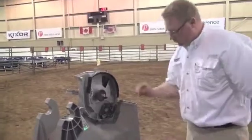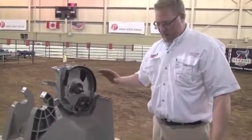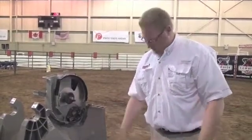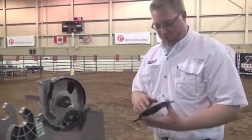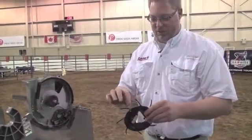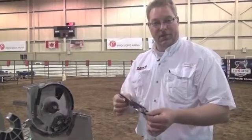Now that we've done that, we can start inspecting our items to make sure everything's still in good shape and clean as needed for winter storage. Starting with the agitator — the last piece we pulled off — we want to check it over and make sure all the fingers are still in good shape. If we start to see any fatigue cracking, or fingers starting to crack or break off, it's a good time to look at replacing this part.